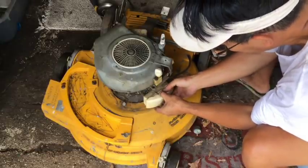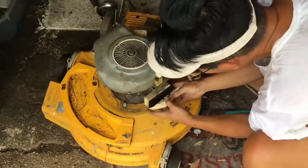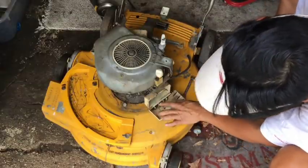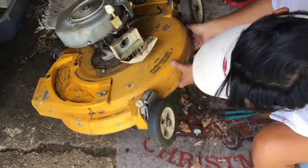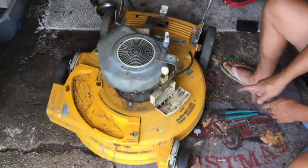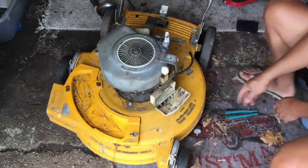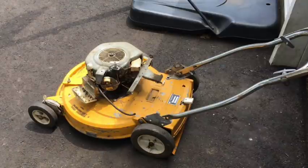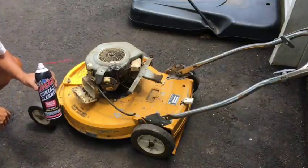Okay, here is the air cleaner, I gather. Part of it. Wow. Because I've never worked on this style Tecumseh before, ever. So I think I should blow some crap in there, you know, some go-go juice, prime it, and then give it a couple pulls to see if we have spark. I doubt it. It might be a points magneto, which would mean I'm screwed. Yes, I realize it's a two-stroke. I'm gonna just shoot a little squirt of contact cleaner in there, same thing as carb cleaner, for my friends over at Lucas Oil.